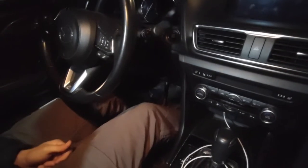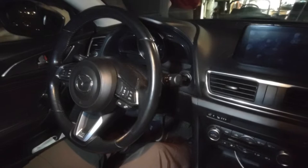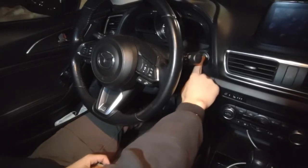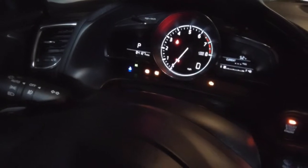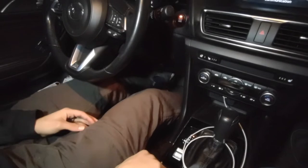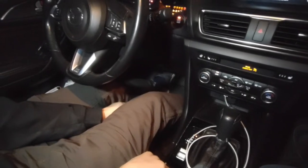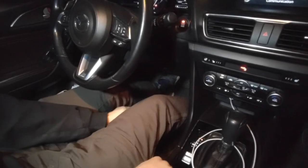Now that we've changed the rotors and the rear pads, we are going to take the electric parking brake off of maintenance setting. So press the start button twice again. Maintenance P with the exclamation point will still be on. Gas pedal all the way down till the click. Pull up on the electric parking brake, hold it. And then while doing that, press the start button 3 times. Still holding the parking brake up and your foot all the way to the floor on the gas. Read all 3 clicks. Okay.